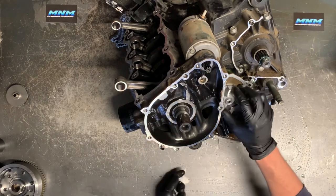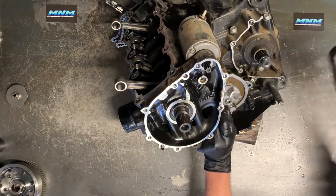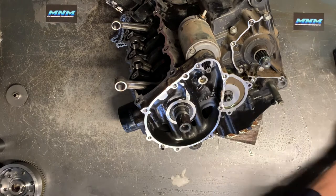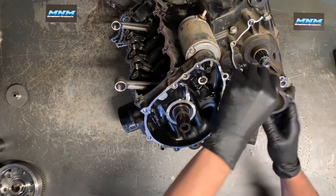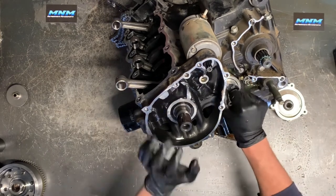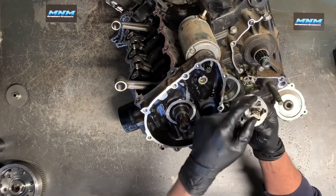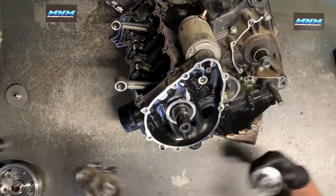I don't like to stick pliers on here because these are aluminum fans — they break very easily. I'm a little wary of using a finger too, but my 3/8 impact isn't all that powerful and I knew I was stronger than that impact. Just make sure you don't catch it off guard. You've got a water pump seal right here — these have a tendency to go out and we'll replace that in a separate video. Make sure you've got a good O-ring on the back. There are also a couple more parts here that are part of the actual oil pump — don't confuse that with the water pump. There's a pin that you want to make sure you don't lose; it sits right down in that groove.